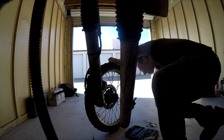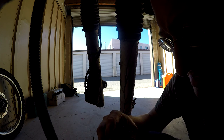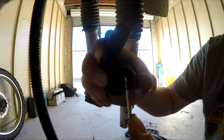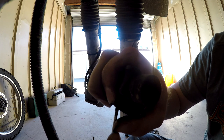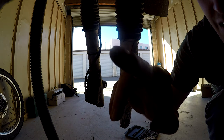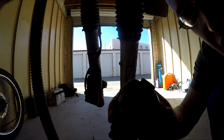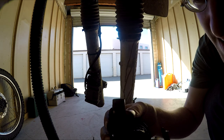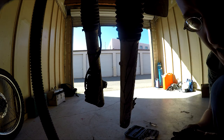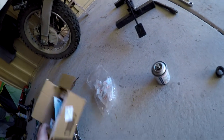There's our front wheel — if you ever need to take the front wheel off an XR, it's a very similar process. The way this works is it's supposed to spin, but apparently it's locked up. This piece turns in here and drives our speedometer cable. The wheel side just has these two metal prongs inside that turn with the wheel — that's how it drives. The wheel side looks okay, which is good. The drive unit itself is super gummed up. I pulled lightly on it and started spinning it out — the teeth interact with this and drive the cable.